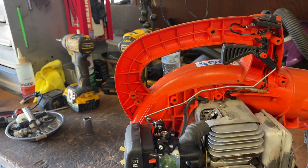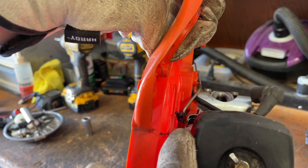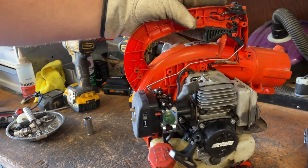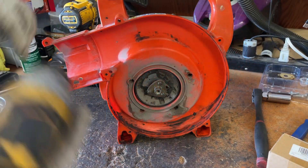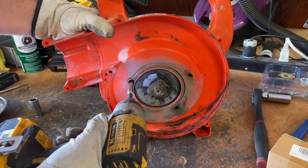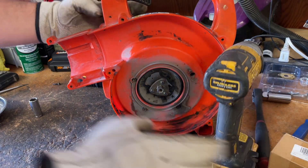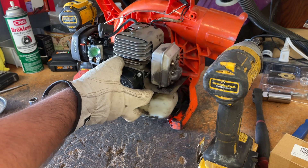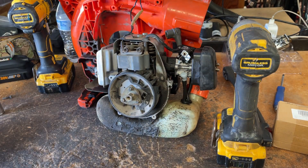Lift the plug wire over that little ridge. So there's that linkage — remember how this goes on. It's pretty simple; it goes in just like that up here. Follow it all the way down — it holds that little ball at the end of that wire. That is going to come out when we pull the engine out of the case. We have to get to the other side in order to get to the coil, so pull these four screws out. Now just pull this out — the linkage out. Now we have access to the coil and everything in the back.